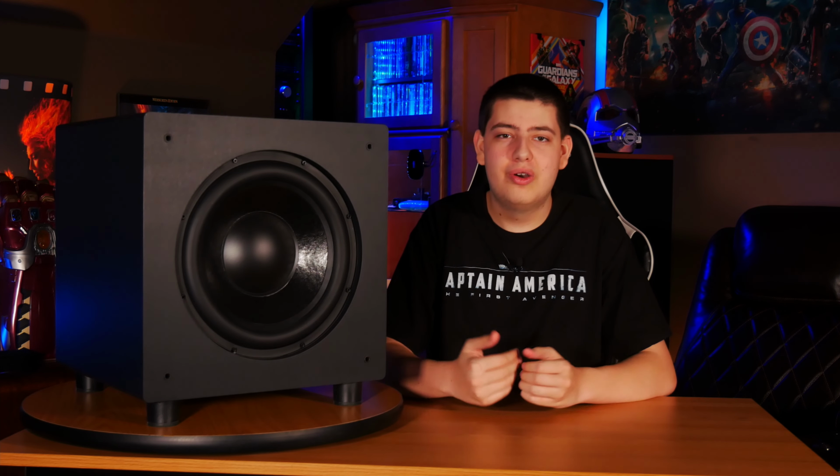Now, when you want to talk about the quality of a certain type of bass, things can start to get a little tricky, but usually music is a good way of testing how well a sub can perform in those higher bass frequencies, and we'll also get an idea of how the sub responds to quick changes in the input signal, otherwise known as transient response. And this is where the SE12 started to show its weaknesses in the face of its bigger brother, the RS11. At times where a track would demand really visceral, impactful bass, the sub did seem a bit boomy, like it had a hard time getting that cone moving right away to deliver a big, impressive sound.